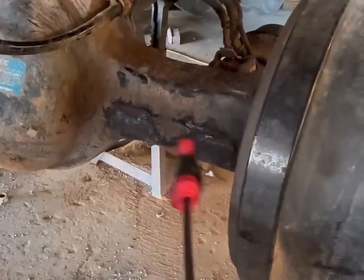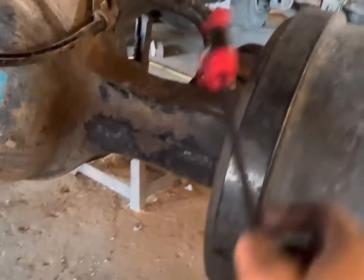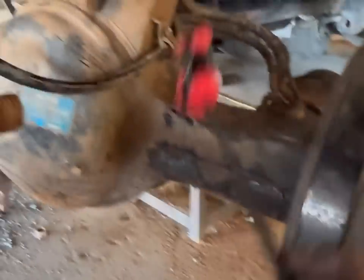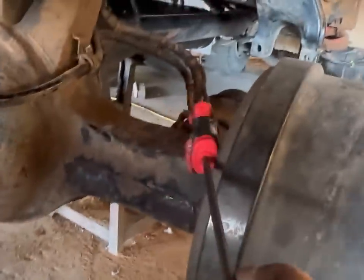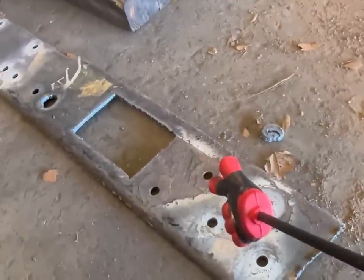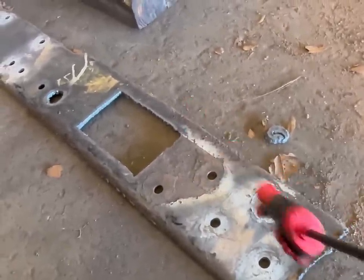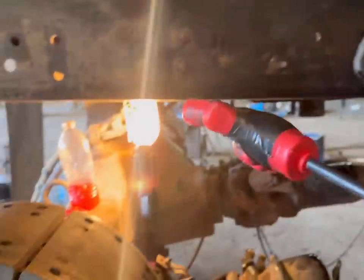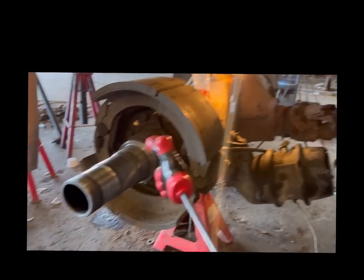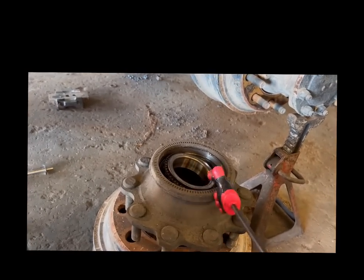You do have to cut loose and remove the lower mounting brackets for the walking beams. As your spring comes down here and goes over the top of the axle and comes down and turns, you have to have room here for the bag inside, and you have to make sure that your brake chamber doesn't hit the bottom of the spring. If you have the old section of frame that the original system came off of — which I suggest getting the frame rail ends — you can cut the sides and use that as your hole pattern. You're going to need seals and whatnot when you swap the spiders.